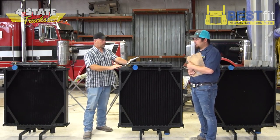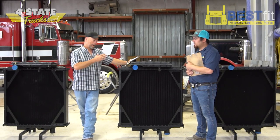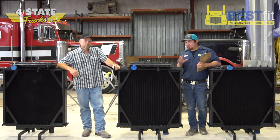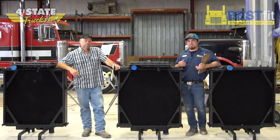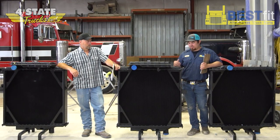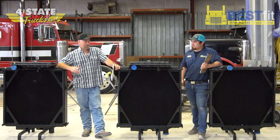If I'm looking at the stock replacement three-row versus stepping up to a four-row, about how much more am I going to spend? You're only talking about 200 to 300 dollars — it's really not a big price to pay for peace of mind and increased cooling capacity. From the stock three-row up to the five-row, you're going to be somewhere around 750 to 800 dollars. Your factory three-row is a two-inch thick core. A four-row bumps you up to a two-and-a-half-inch thick core — that's about 25% more than factory. The five-row is a three-inch thick core; that's a beast — it can handle about a thousand horsepower and adds about 33 to 40% cooling capacity over a stock radiator.